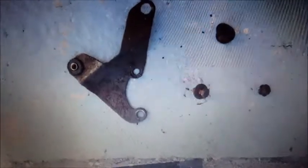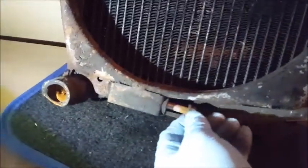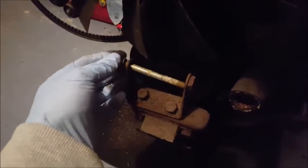I can't find it at the moment, but that's a picture of what it'll look like. I'll wire brush it up — I might have to get a new bracket, but they're not too expensive. The last part holding the radiator in is this long bolt that goes through the bottom here and attaches to a bottom bracket. The radiator goes over there into this slot here; this goes through the bottom of the radiator, and this is a captive nut here — it just screws in and holds it in place. It took a bit of a wiggle to come out, but once it was out, the radiator just lifts free.